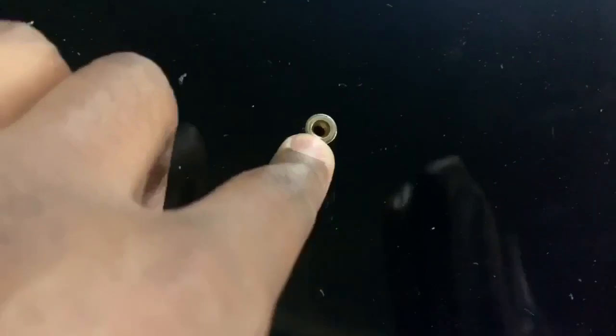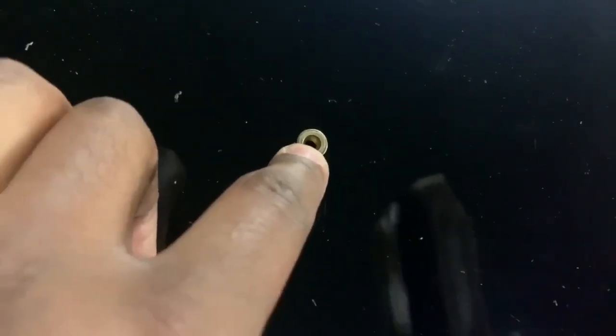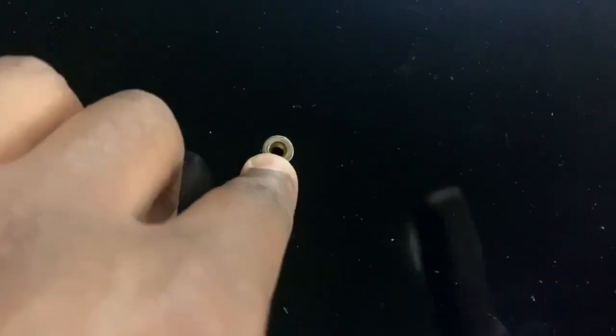This one's already done and in. I was worried about the inside — now that you've drilled this hole, it's bare metal exposed on the inside. I think this trunk is aluminum. Either way, the rivnuts pinch the sheet metal together so moisture isn't going to get in there anyway. And even if it does — it's a 14-year-old car.